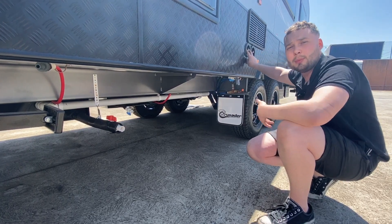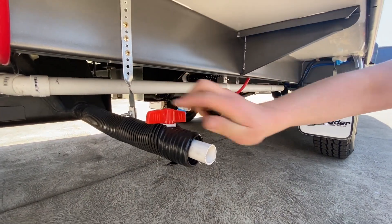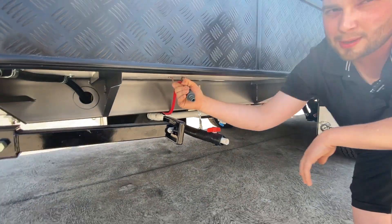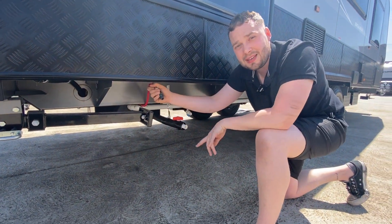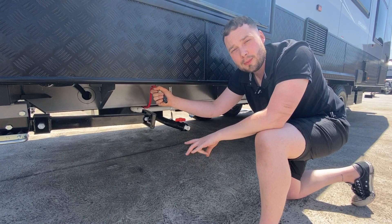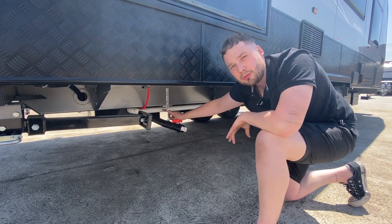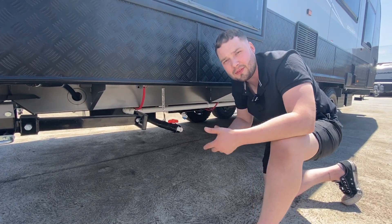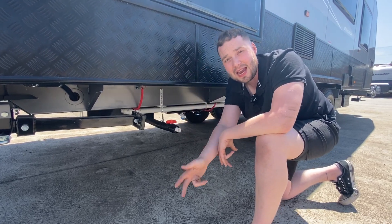Mains pressure fillers suck water straight to the tank. These external fillers are almost redundant but we include them. You've got water tank emptying and grey water tank — close it off and you've bypassed into the grey tank. If the grey water tank gets smelly you can flush it. The smell traps are fitted by qualified plumbers so you won't smell any mildewy smell inside. Smell traps, cleaning system, and tank gauge come standard with the Excalibur range.